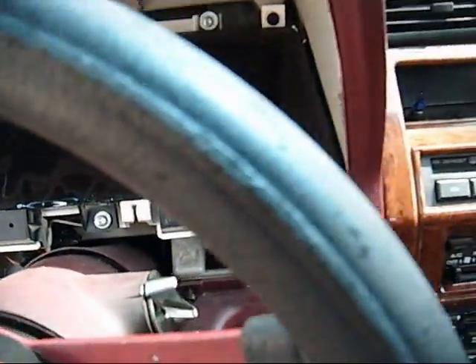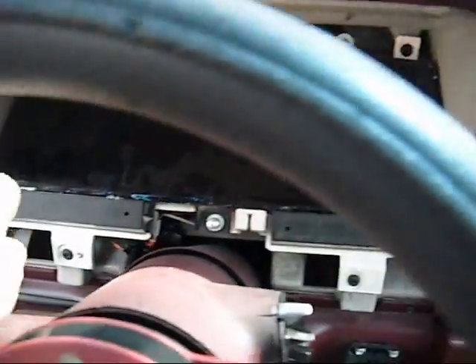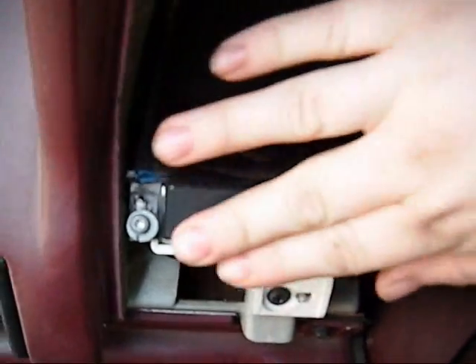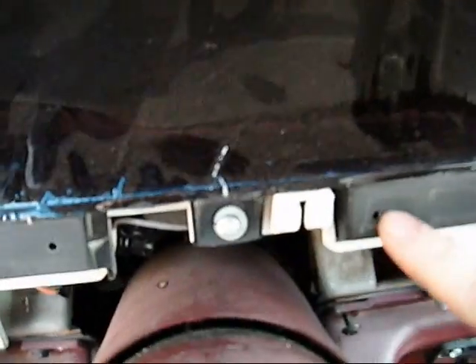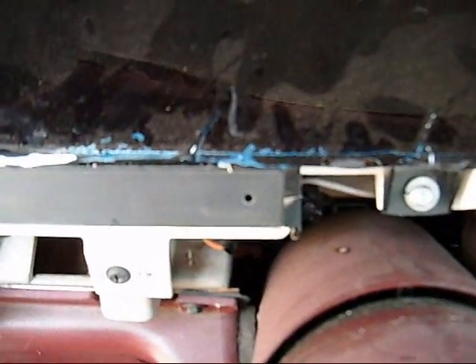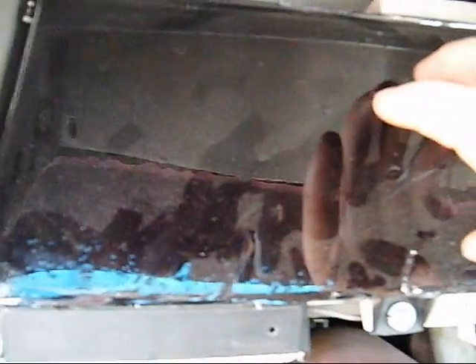From the outside it even still looks relatively normal, but as you'll see when I get this pulled out, I had to do a lot of cutting of the plastic. This plastic piece on the outside was used where you can see indicators - this one says brake, there's the oil pressure one. The two inner ones weren't used, so I drilled holes in them and put red bulbs behind them so that became my signal light, because on the Digi dash itself there's no actual signal indicator. On the original cluster for the 86 Luver it was built into the bottom, but I had removed it, so I basically just wired in some bulbs myself.